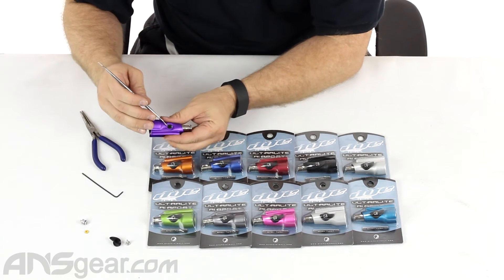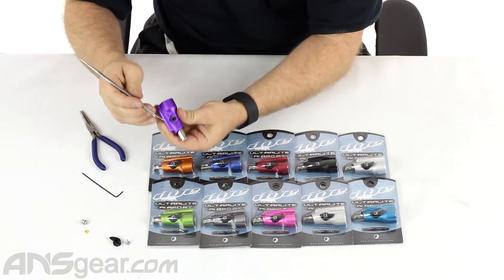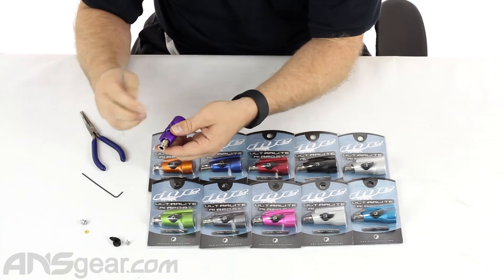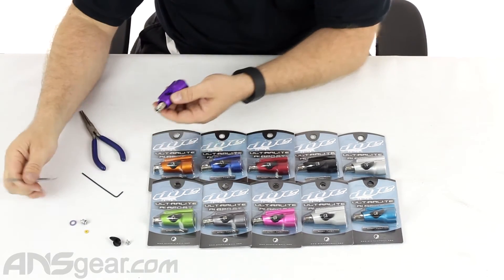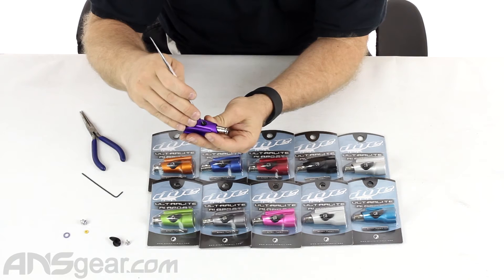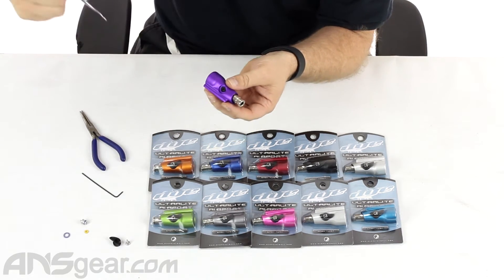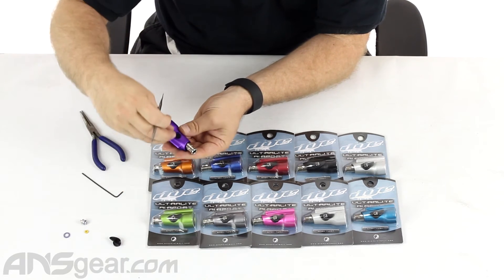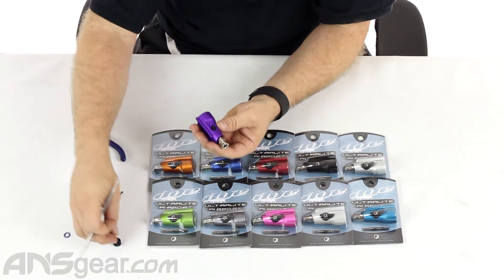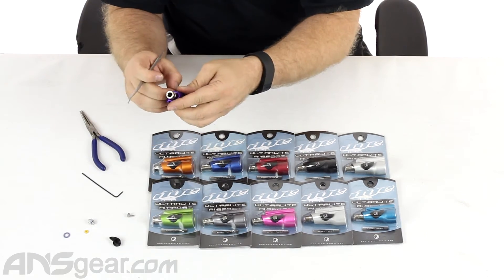So now that we've got the core out, there's an O-ring that rides around this cam, and there's a cutout in the side right here which lets us get a pick in there. We can kind of scoop underneath there and get the pick out. Pull this O-ring out. This O-ring doesn't seal anything — it doesn't hold air inside of there. What it does is it keeps this core from wanting to pop out. If you didn't put this O-ring in and you assembled this back together, this piece would just fall right out. So that O-ring keeps this cam from falling out at any given time.